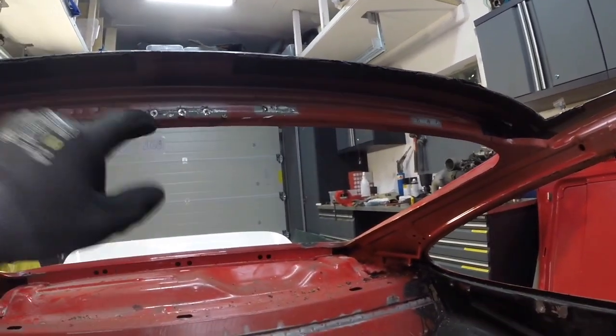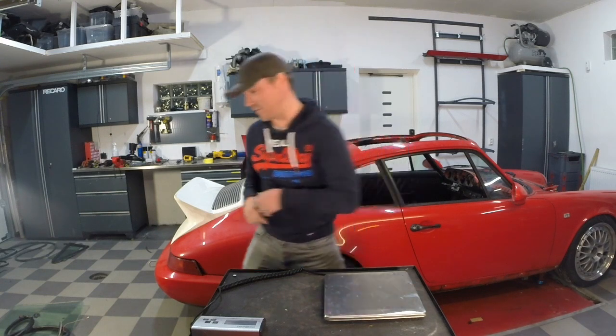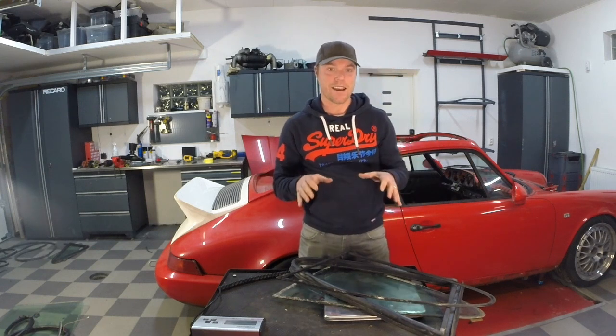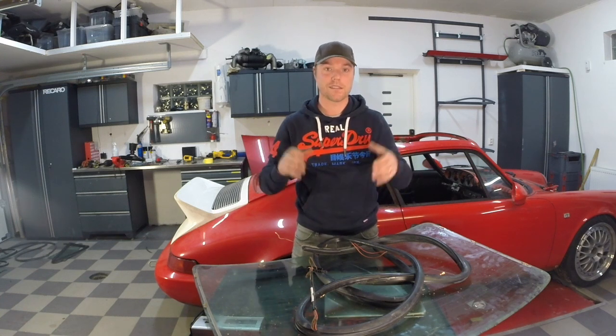As you do this, there's also a lot of bracketing. I've taken this out with the spot weld remover, so that's pretty easy, and there's quite a lot of it all the way around. Now for the scoring: the rear quarter windows with the window, seal, and trim — this is going to be Lexan flush-mounted in the end. It's 3.2 kilos for both right now, so 1.6 kilos each. Reading up a bit on the internet, it says I'm going to save between 1.5 and 1.8 kilos on both together, so I'm going to use 1.5 kilo of weight saving for this. The rear window together with the seal is 8 kilos — flush-mounted means a much simpler seal, and the rear windscreen is made of Lexan so it's much lighter. We'll end up with about 4 kilos weight saving on that, so in total for the windows we're up at 5.5 kilos weight saving going to Lexan.